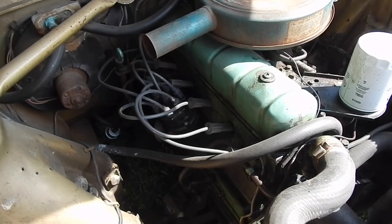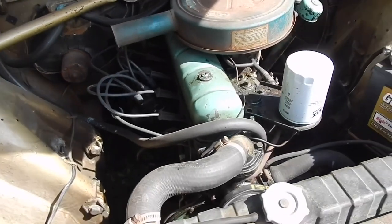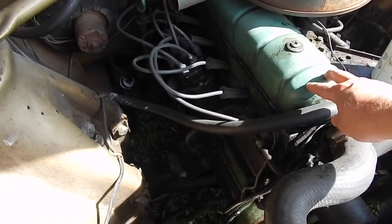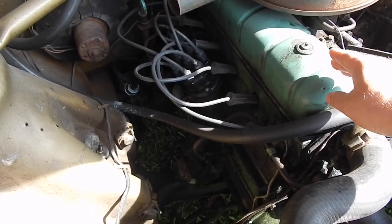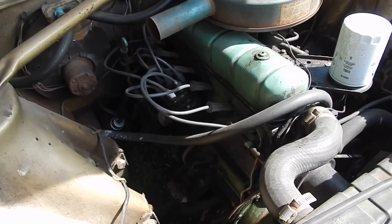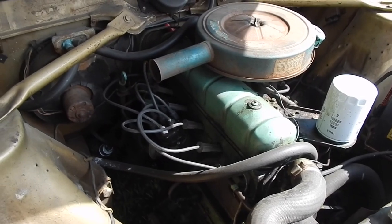It was a yearly tune-up — you could take it to the garage or do it yourself at home. But people didn't do that. The head bolts worked themselves loose, they'd get a head gasket leak, the head warps where it overheats and cracks, and therefore they kind of got a bad rep for that. Do your preventative maintenance on it and she'll take you across the Fruited Plains without issue.